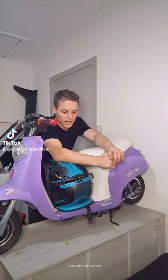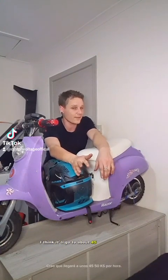It was still only hitting about 33 k's an hour and I was like, what the hell — I'd spent all this time and effort, wired up the display, headlight, tail lights, everything, and it was only doing 33k. I wanted to go quick. So I put an 800 watt electric scooter engine on the front — it's still in there now — and that engine produced quite a bit of torque. Between the 48 volt 1000 watt on the back and the 800 watt on the front, it got to about 45-50 k's an hour.